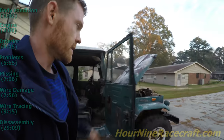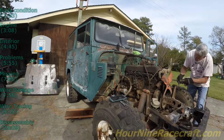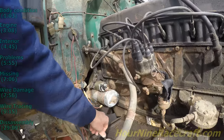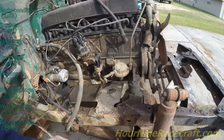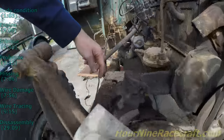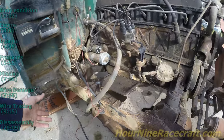That's it for this — I'm going to start taking the front panel off, the header panel around the headlights. This is the FJ with the whole front off. We got most of the stuff just disconnected from the engine. The fuel line busted whenever we were pulling that off, and we just have the other end capped off right now. Most of the bolts broke even though we heated them up and sprayed them with PB Blaster. We'll have to drill them out — there's a small access hole underneath in the side of the frame so I could probably pull it out that way.